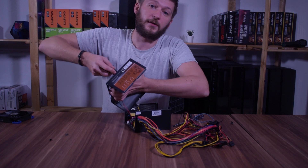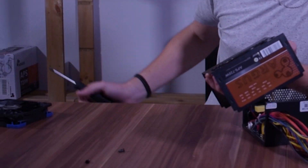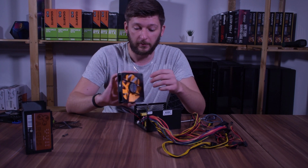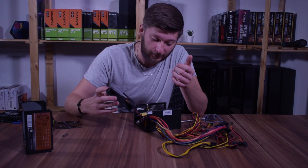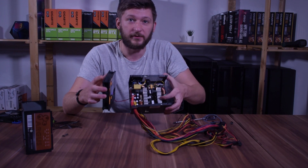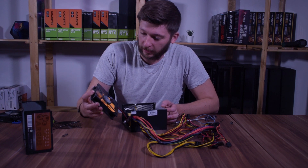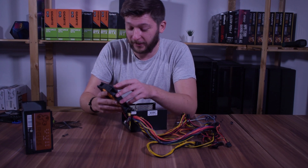Again, especially when I start to fiddle around with the wires — this is a do-as-I-say, not as I do channel. Just don't do it. An interesting thing is that on cheap power supplies, you usually end up with a fan with this little plastic piece, and I just don't get why. It is just emitting noise, it has no real purpose, and it is blocking airflow going down on the left side where there is actually a heat sink. The fan we will put in here doesn't have it, so I really don't care.